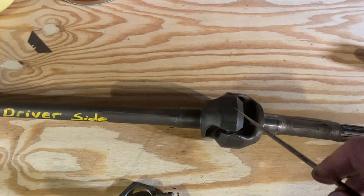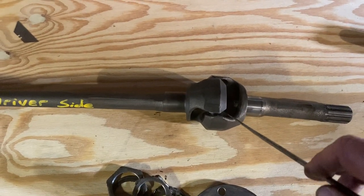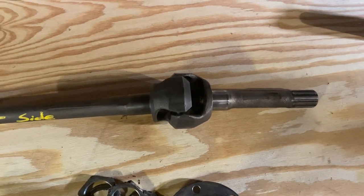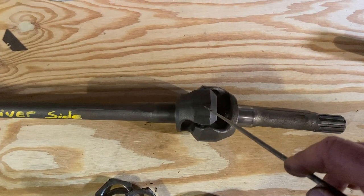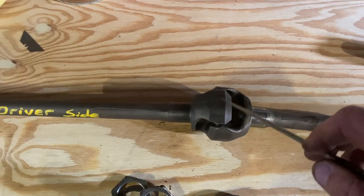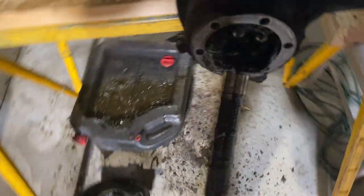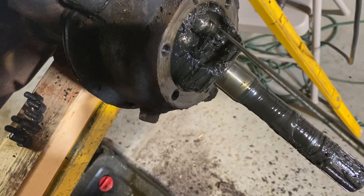Be careful with these Bendix axles because you can pull them apart — it takes a little finesse but they will come apart and those steel balls will go flying everywhere. There are five of them, about three-quarter to one-inch diameter balls, and there's a little pin holding the middle one. That stuff is just sitting in the grease so it rotates and moves around — be careful when you pull these out because they will go flying and you'll have to find them all.